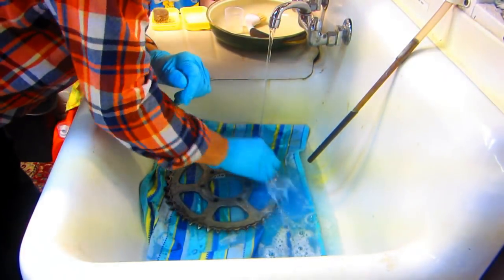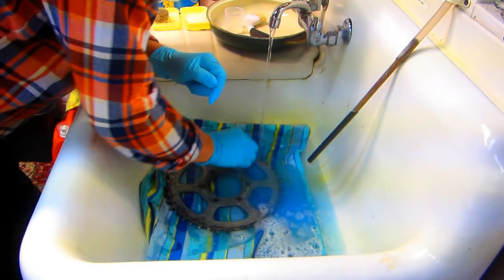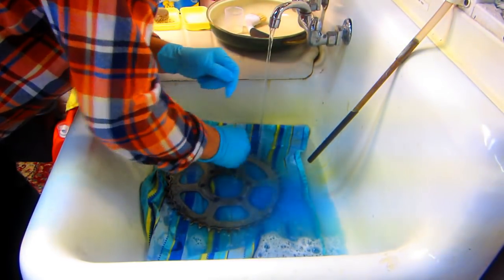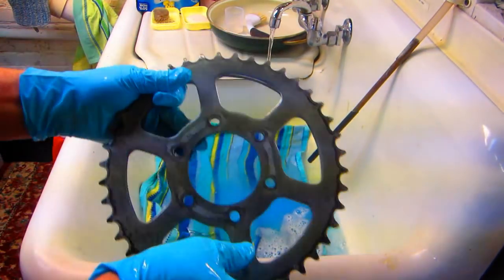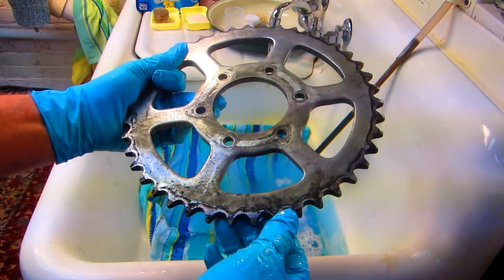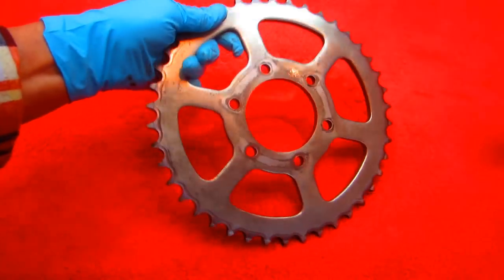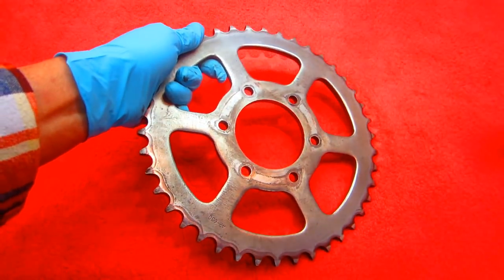Now, the easiest way to get a lot of grease off really quickly is to use water as hot as I can make it. I don't want to contaminate any of my material in the shop, the cutters, the wire wheels, or anything, but ordinary SOS, hot water. I'm not sure you can see the grunge coming off, but the parts that are really dirty, it does take most of the grease off. So even if this was the only cleanup you had done, this certainly would be an upgrade over what we had 5 or 10 minutes ago.